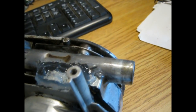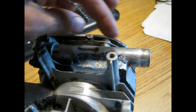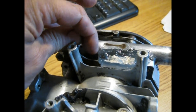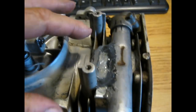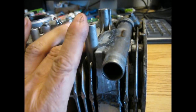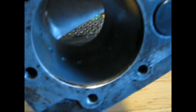Because I'm mounting a regular carburetor in the standard location, I used the intake manifold complete and bolted it to the block just for location purposes. There's a sheet metal wall in here that blocks the original intake, and it's completely blocked up in this area with JB weld, which slopes it in — comes in and then heads over and down. JB weld and silicone were used to seal that up. It feeds from the carburetor down over to the left into this area and out through the inlet ports into the cylinder, controlled by the piston.